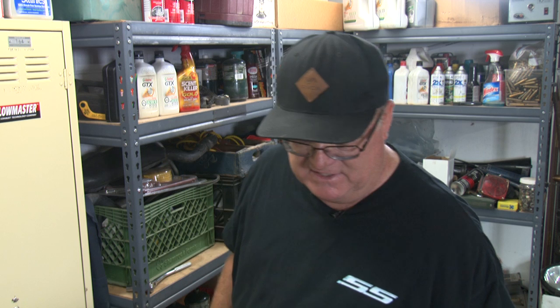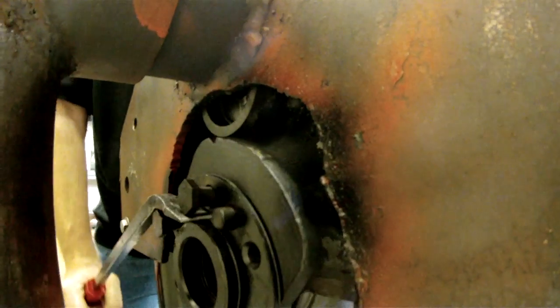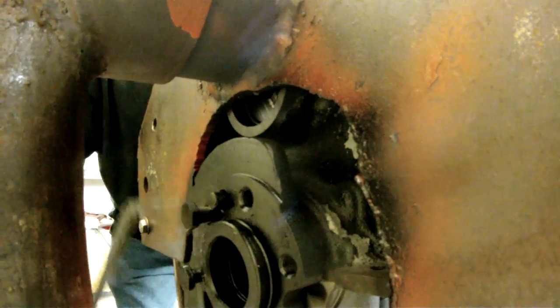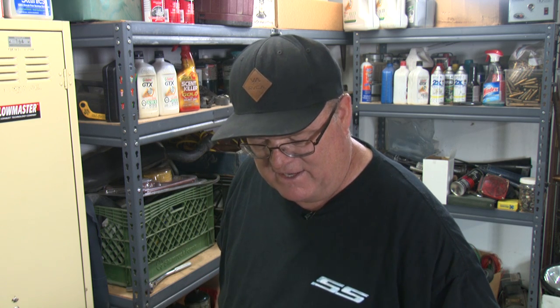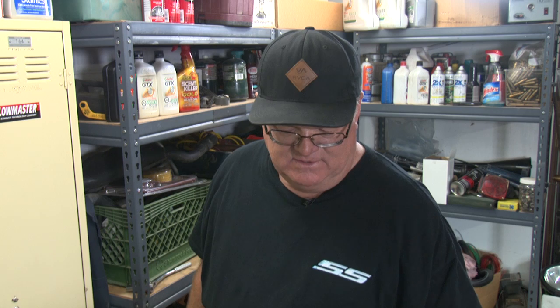What you do, like we did in the previous video on hydraulics, is rotate the engine. If you've got it on the engine stand, you can rotate it with a couple bolts in the crankshaft and rotate it with a long pry bar, until you get one valve going down and the other is loose. Start on number one and work your way down.